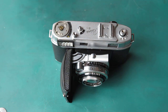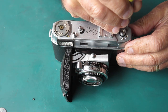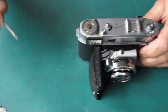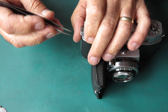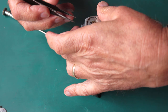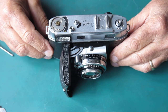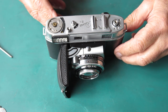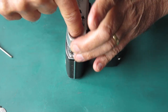To take the top off the camera, this part is the same as the other camera - two screws here and one at the end of the top plate. On this type of camera and on the three big c cameras: do not just rip the top off at this stage or you'll probably cause problems. Hold your finger on the center of the meter, then lift the top off - give it a bit of a wiggle and lift it away.